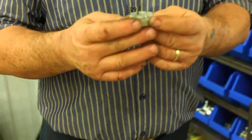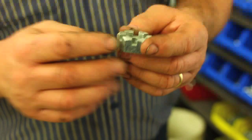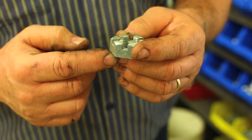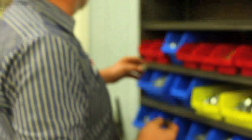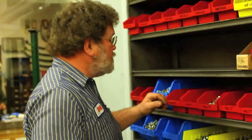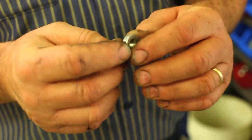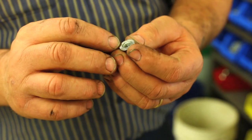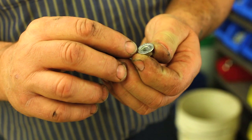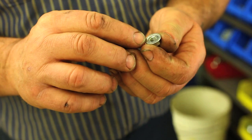If you want to make absolutely certain that they don't come loose, then you use a castle nut and a split pin — those don't come loose at all — or a castle nut and lock wire. There are other nuts not common to the MG, like this American manufacturer incorporating serrations on the washer that are part of the nut, to prevent it from loosening.